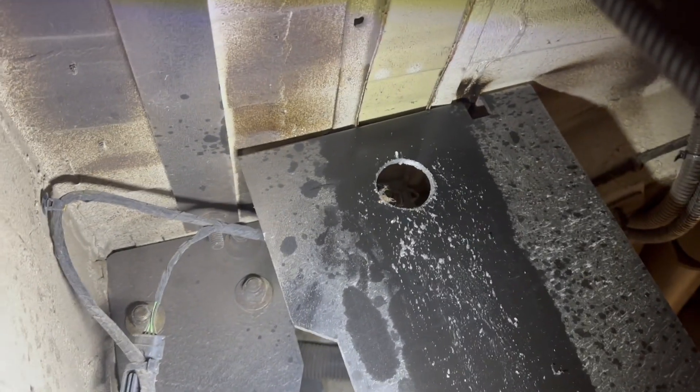The reason you really want to run a DC-DC charger with these 460 amp-hour batteries is that, unlike pretty much every other lithium battery BMS out there, these 460 amp-hour ones require — or get a little cranky — if you try to charge them much over about 14 volts. They really prefer about 13.9 to 14 volts. If you try to get them up to 14.4V they'll give warning errors. It's not going to damage anything, but I'd rather stay within the manufacturer's specifications.